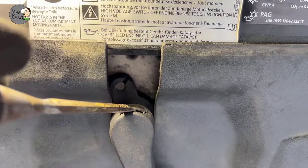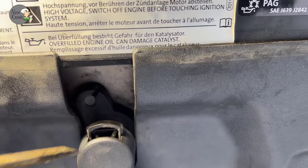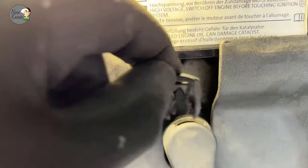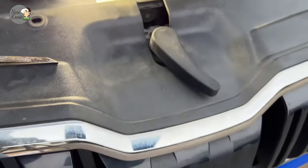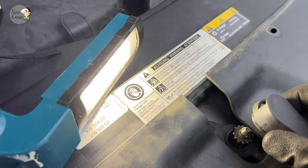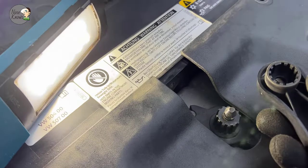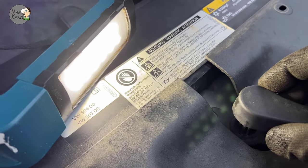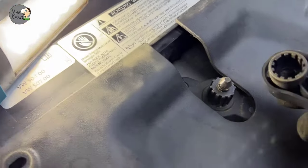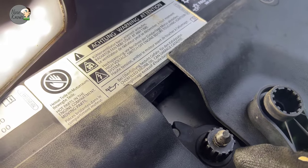Before we can get busy removing that top scuttle panel, we need to remove the bonnet lever, which is in the center. To do that, use a flat-headed screwdriver - just pop it into the little ridge there and lever it forward, releasing the small spring clip that retains the lever in position. There is only one clip holding it, so once that's off, put it somewhere safe and pull the handle off. There are two larger splines so you can't get it in the wrong position - don't worry about marking it.